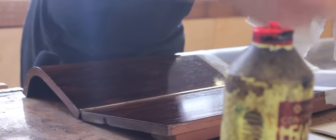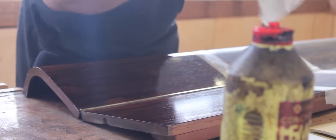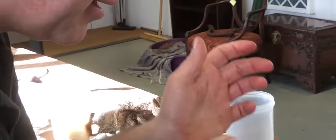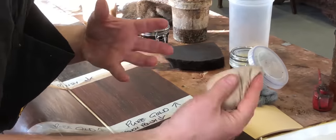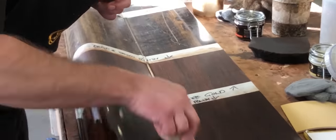I'm still going to keep the same face to the rubber as well. We could change that to get rid of the oil that was remaining on it, but it's quite messy. The idea is that the meths penetrates into the surface of the polish and removes the oil. The oil will stop it from drying, so we need to take that oil out. This is a very, very quick process. I don't want to be on the surface very long at all,